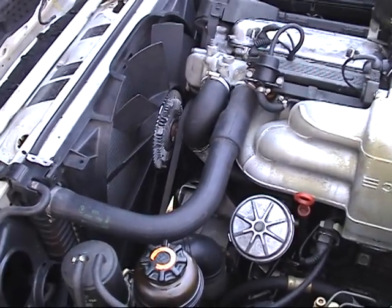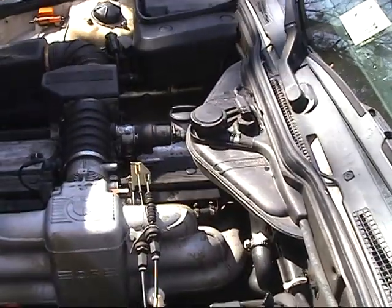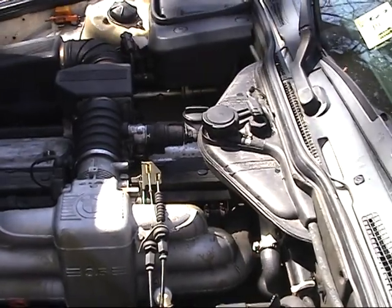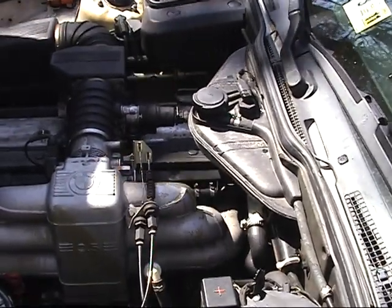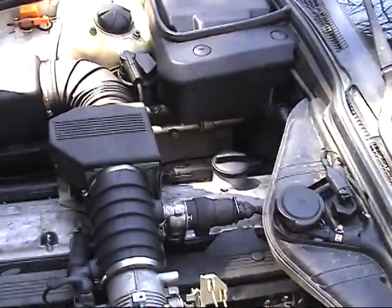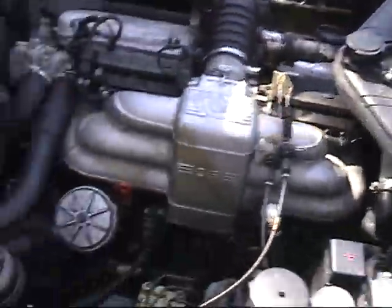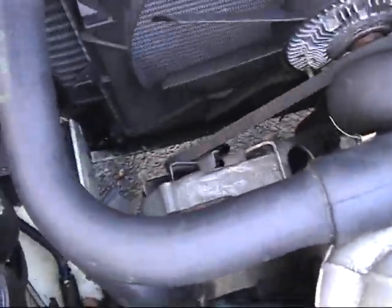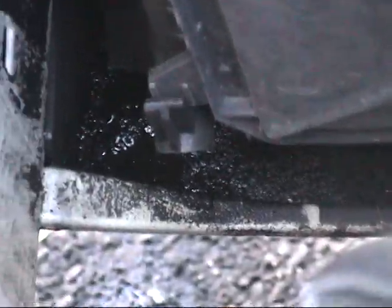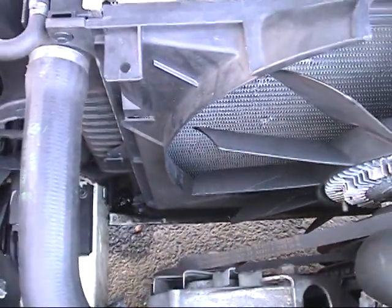So I'm really just thinking that my system is clogged, that for whatever reason it's not letting the new coolant flow through the system, and it's building up pressure. When it hits X amount of pressure, it's just throwing up all the coolant through the overflow tube. So yesterday I figured, might as well get going. I undid the drain screw, which should be right there. It's out right now. It drained the radiator.